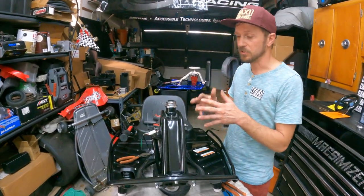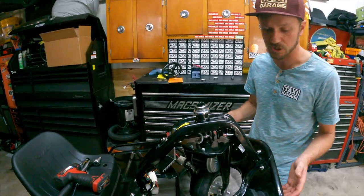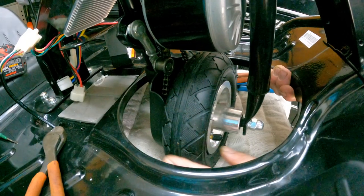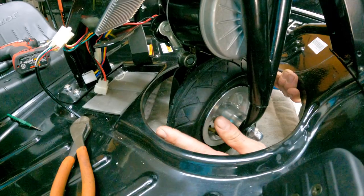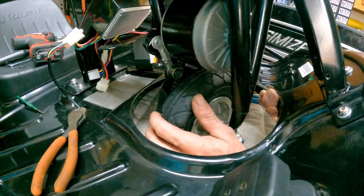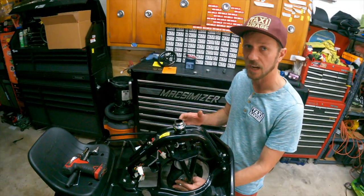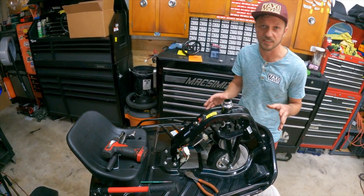Another tip about steering wheel shake: check your tire. A lot of times these tires can have a flat spot, and if the air tire isn't inflated to about 50–60 PSI for an adult rider, you'll feel a lot of vibration from the tire not being perfectly circular. The Taxi Garage tires are a harder compound than normal solid tires and eliminate that issue. We recommend getting a solid tire and doing the headset bearing adjustment to almost guarantee getting rid of those problems.